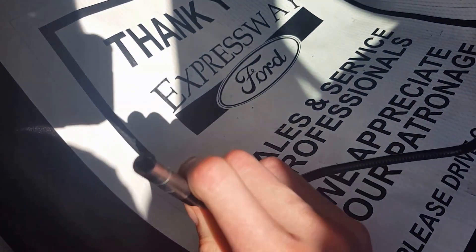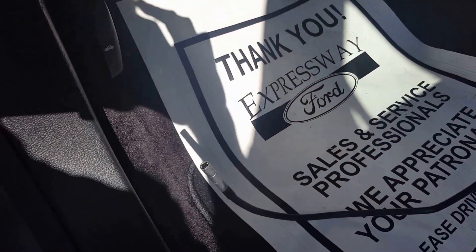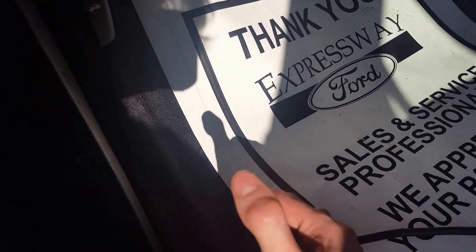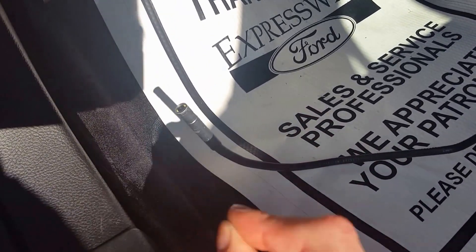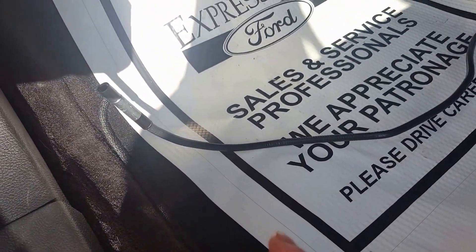Sorry for all the movement. I was able to figure mine out with this little borescope — just shove it behind the fuse box and it connects to my phone so I can see what I'm doing. There's going to be a little white tag on there with a bunch of numbers, and it'll have the key code. That's what you're trying to find — the keyless entry code.